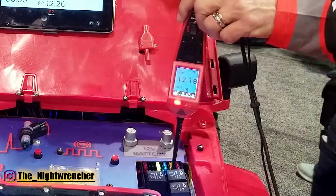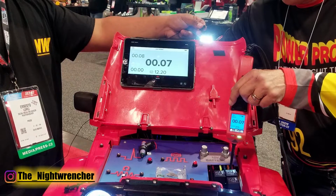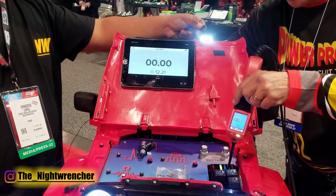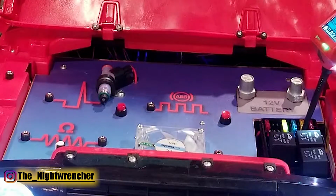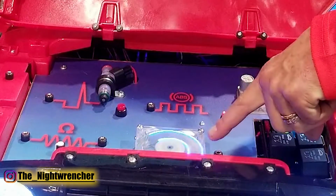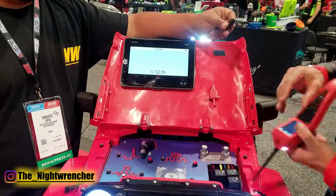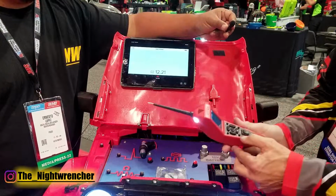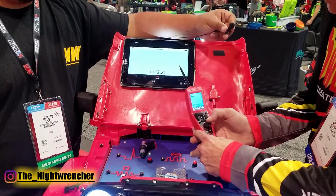Okay, I've got power on the right pins. There's my control signal for the relay, grounding it. So the last pin is the component that I can fire up by applying power from the tool. That's activated my fan. So I've analyzed everything on that circuit. I'm going to turn the speaker off here real quick and flip the screen back over.